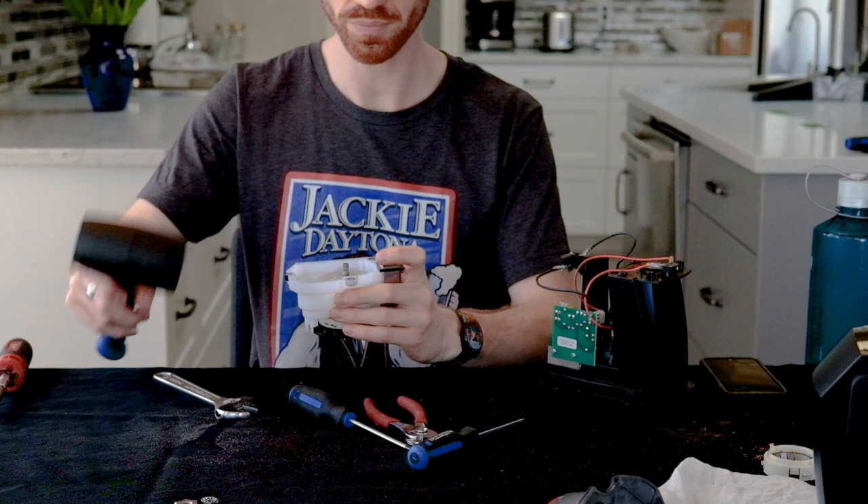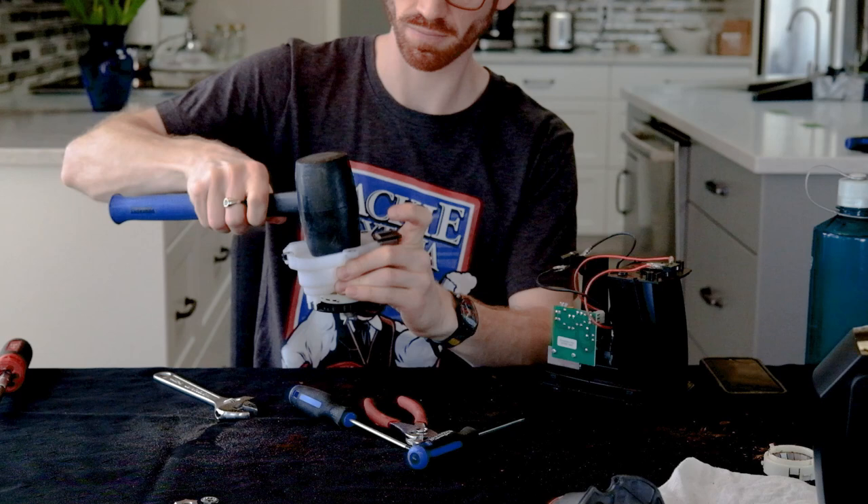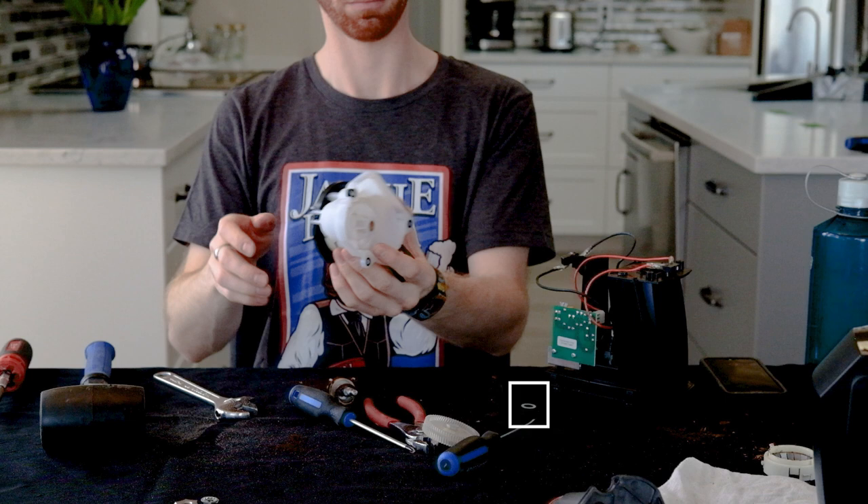Okay, pause. I'm about to hit the metal shaft out of the gear assembly. You're going to need something firm but something that's not going to damage the metal when you hit it. I've chosen a rubber mallet, but you can use the end of a screwdriver. Just try not to hurt yourself. Maybe don't do this in the air like I did. Baratza carefully calibrates their grinders so there's no vertical play in that burr shaft. Every grinder has a stack of washers that are slightly different thicknesses and they all go specific places, so make sure you keep track of what washers went where.